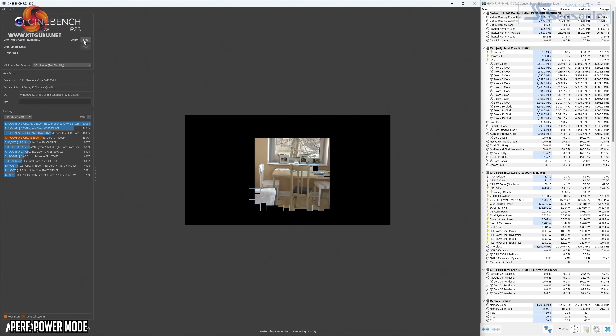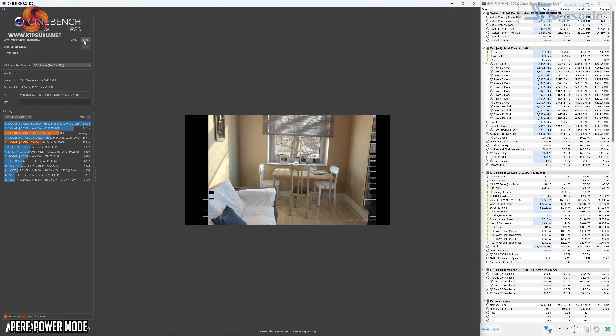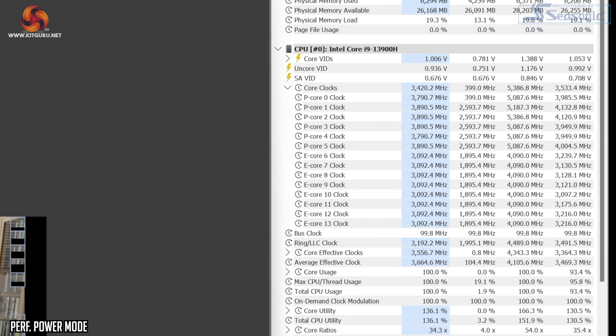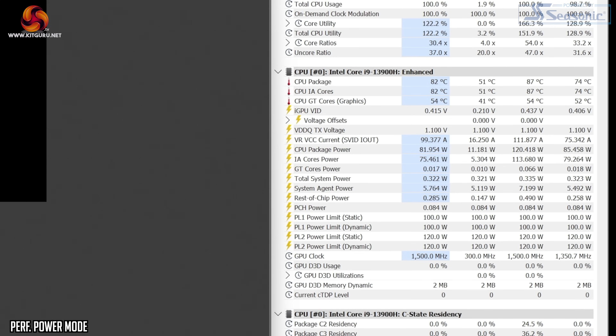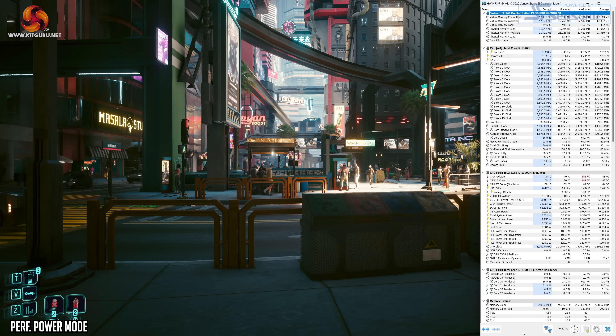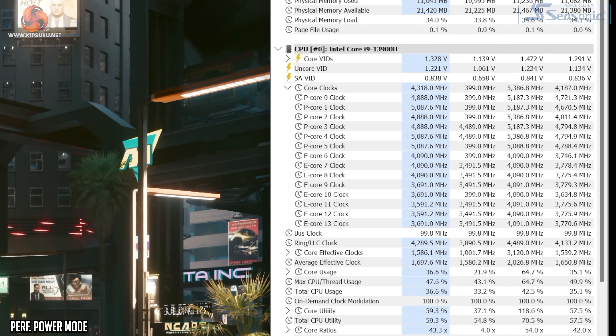In games, the CPU draws about 45 to 46 watts in normal mode but bounces between 4.1 and 4.2 GHz on the P-cores, with package temperatures never exceeding 80 degrees. The performance mode cranks things up with a 120-watt PL2 where the CPU hit 4.4 GHz on the P-cores in Cinebench before dropping to the 100-watt PL1. However, after a minute or two I noticed certain cores momentarily dropping to 2.5 GHz, and after 30 minutes this was a very obvious occurrence. CPU package temperature was around 82 to 85 degrees, suggesting possible VRM issues with the tiny laptop-grade hardware, with actual package power closer to 85 watts by the end of the test.